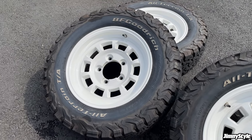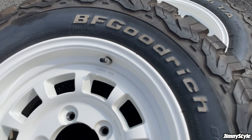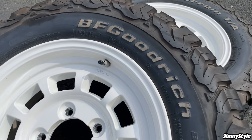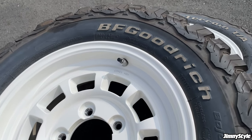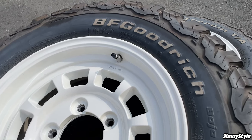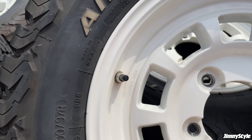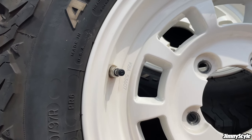Another thing to think about with the Jimny is TPMS sensors. If you live in the UK or elsewhere in Europe you'll likely have these sensors that monitor your tyre pressure. They're typically a legal requirement in most European countries, so when swapping to a new set of wheels and tyres you need to decide whether to reuse the original TPMS sensors — which means removing the tyres to get them out — or fit a brand new set. We have OEM specification ones in stock and you don't need any special work to get them working with your car. Simply fit them to the new wheels, drive a few miles, and they'll eventually sync up.